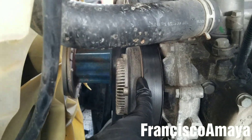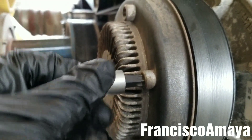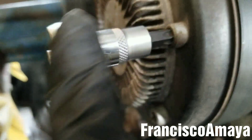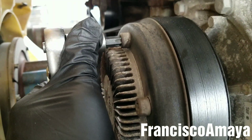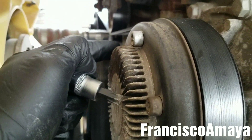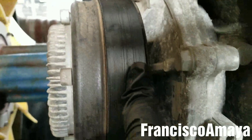The first thing to do to remove this water pump is to loosen these bolts over here using a T50. They're going to be a little tight so you better be careful to put the T50 well and then pull it to the left. Don't remove them — just get them loose — because we're going to remove the tension of the belt first.